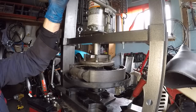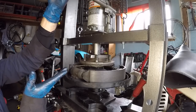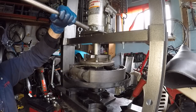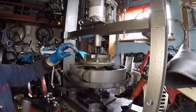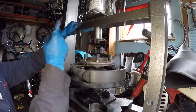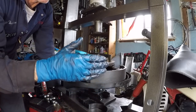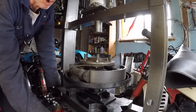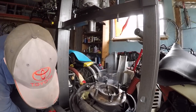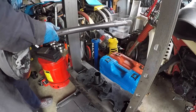Everything got really firm, letting you know the bearing is fully seated and the outer retainer is fully seated against the bearing. Release pressure on the bottle jack and get the assembly off the press. Screw the bar screw back in, lower the crossmember to pull the assembly up and out of the cross bars, then bring it back to the bench.